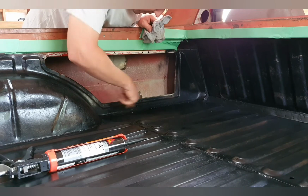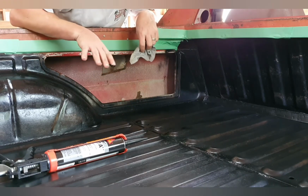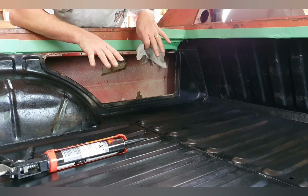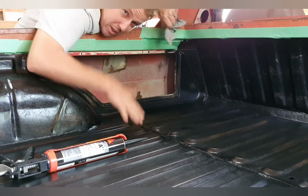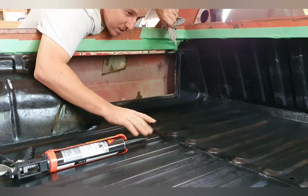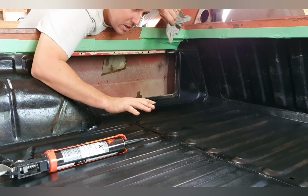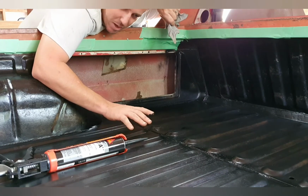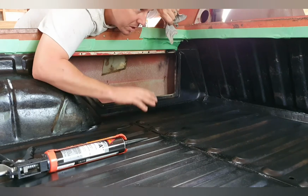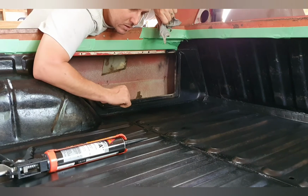The Raptor liner is really going to seal the surface and never ever come off. So we don't want to have this situation where we've got the Raptor liner and then rust getting in between that and the metal surface here and really just going to town under there. So the better we seal this up, you know, this is all primed, back to bare metal primed, sealed all this up. When you hit it with the Raptor liner, she's going to be a done deal. Let's move forward.